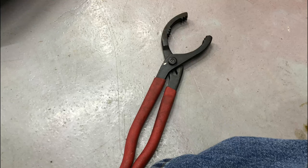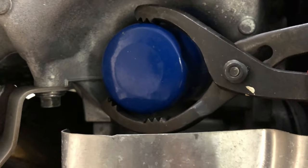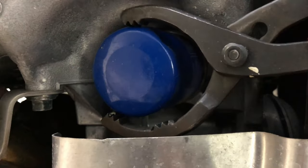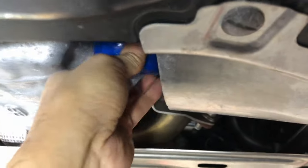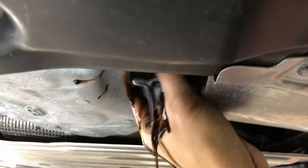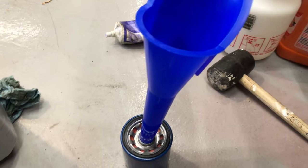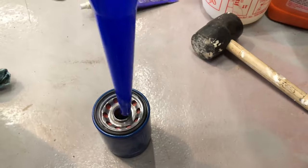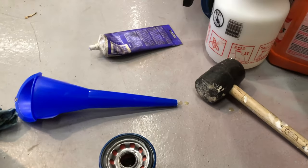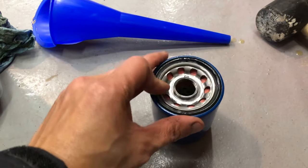Here is the oil filter wrench that I like to use. It works on many different cars, assuming that they don't use some sort of proprietary housing of any sort. Here we can grip it from the right side. Unfortunately, this is one of those cars where removing the oil filter makes a mess — I couldn't find a way to avoid it. For installing the new filter, some people like to pre-fill it. Since this filter is not installed upside down like on Subarus, I opted to pre-fill it a little bit. However, the rubber seal on the top does have to be lubed up with fresh oil — you do not want to install that dry.